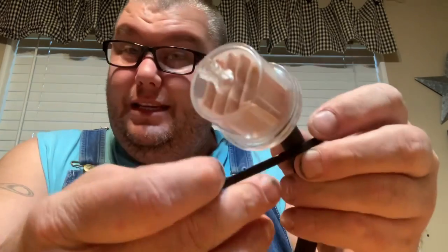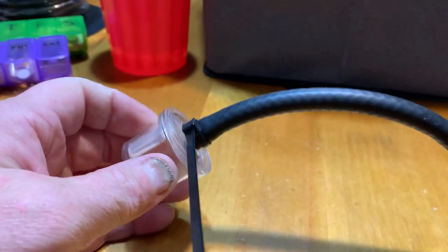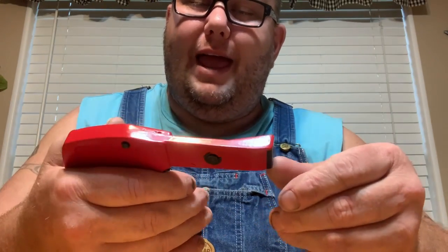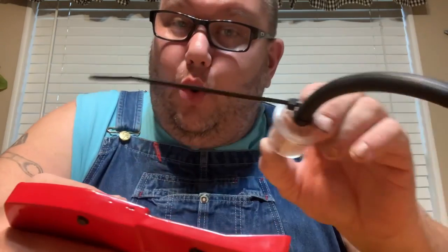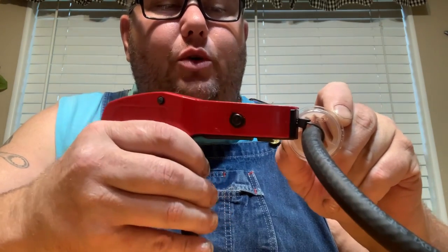So you've got your fuel line on and your zip tie ready. What I always do is just go ahead and get the zip tie on and cinch it up by hand. These need to be torqued to a certain spec. Here's the tool that you need — if you don't have one of these, I'll put a link in the description below and in the comments. This is going to torque the zip tie to 60 inch-pounds, and once it reaches that torque, it cuts it off flush. It's just so cool, so let's give it a try.